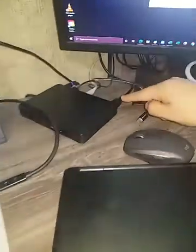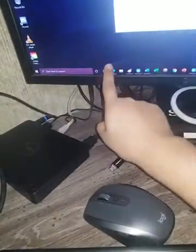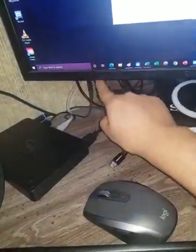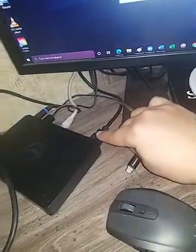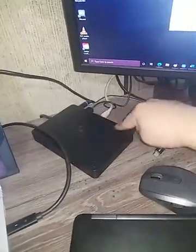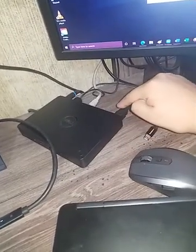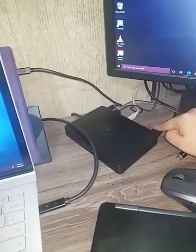Also, I've tried using a mini DisplayPort cable instead of the VGA to HDMI cable, connecting directly to the dock — and the same result. So it's not the cable. I've ruled out the cable as the cause. I'm open to any ideas — thank you guys.